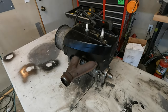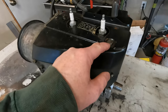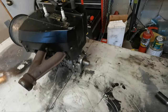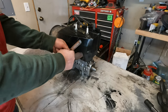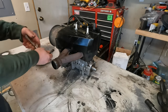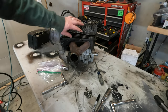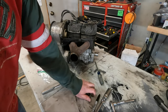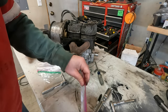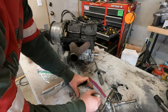All right, back at this Kawasaki 340. We'll start off by taking the spark plugs out and get this sheet metal off — there's just some 10 millimeters and looks like 12 or 14 here, and I'm missing one. Got the spark plugs and upper tin off. I'll use some Ziploc bags to put all the hardware in so I don't lose it, and label them with a Sharpie — like 'upper tin.'